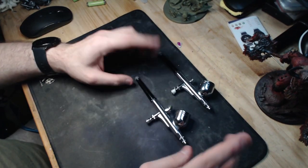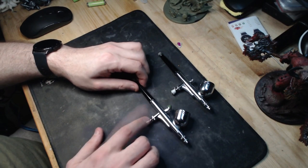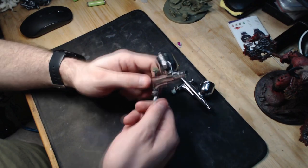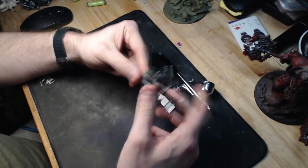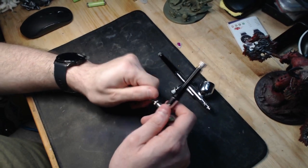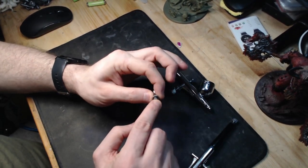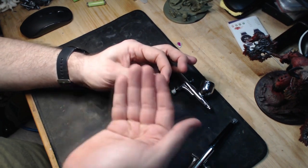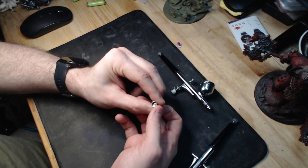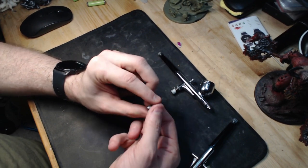Now, the first thing I would suggest to people is to check your, in essence, what's known as a triggerable Schrader valve. If you own a bicycle or a motorbike or a car, they all come with what's called Schrader valves on the tires, where you push down, put air in, release, and a plunger comes back and stops the air from coming back out. That's called a Schrader valve. Well, inside this Schrader valve is a spring. Now, you can get a specialty screwdriver